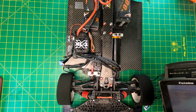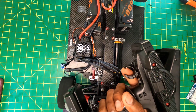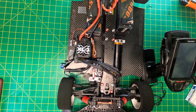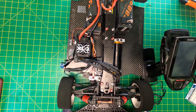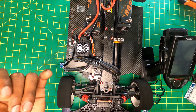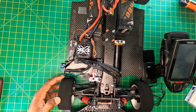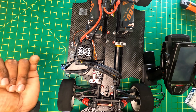I like to have throttle and reverse set up so that when I go into full reverse on the remote, it's going to do ABS braking instead of actually reversing — that way I don't overload the ESC or cause it to catch fire. A lot of guys are overloading their ESCs because they have incorrect brake settings — too much braking, drag braking, or full braking. For speedruns, stay under about 50% braking, and set ABS braking on your receiver if you can. ABS braking pulses rather than going into full reverse, so you won't stress the motor or ESC and you can slow down your vehicle safely.